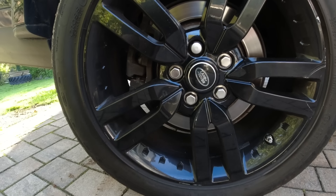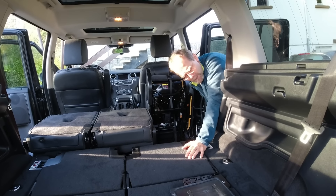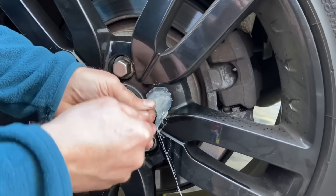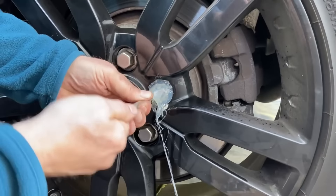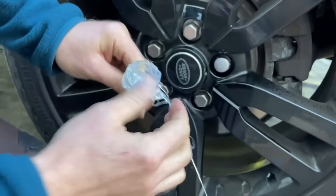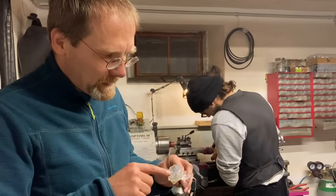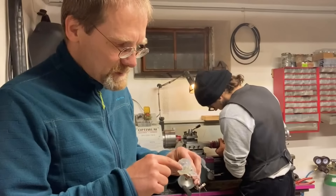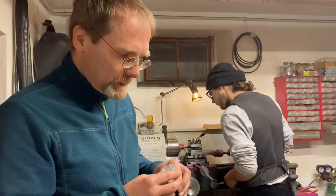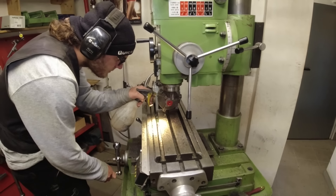It has a safety lock nut and the socket is missing, so Christian has to make one. I'm making a casting of the security nut using WD-40 before adding glue. Robin is machining the nut. The next step is to weld pieces back in and machine them down to match exactly what the lock nut looks like. Robin is putting a 24-millimeter hex head on it.